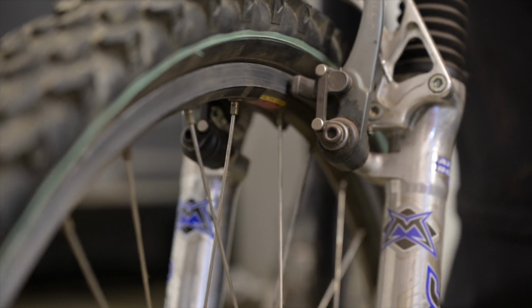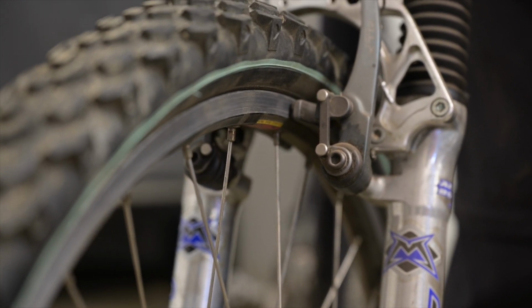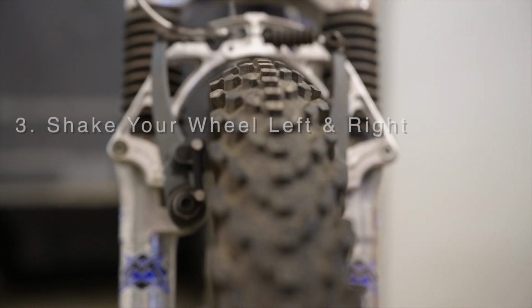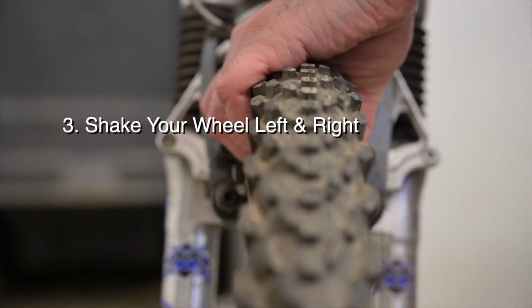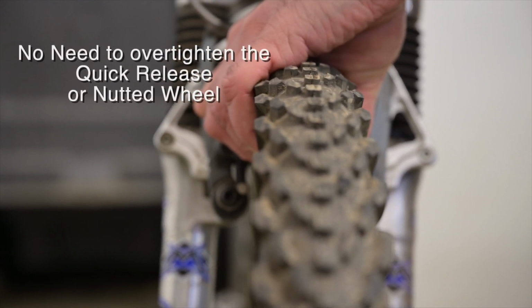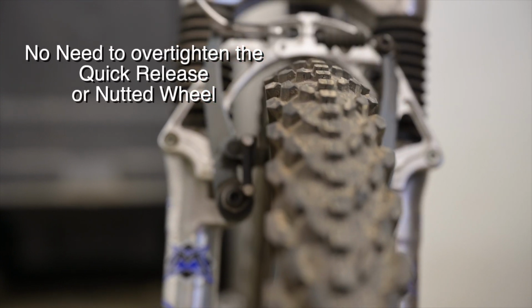If you have disc brakes, click on the video above or in the description below on how to adjust your brakes. 3, wiggle your wheels to make sure it doesn't sway left or right. If it does, tightening the outside of the wheel does not work. This has to do with the cones of the hub.